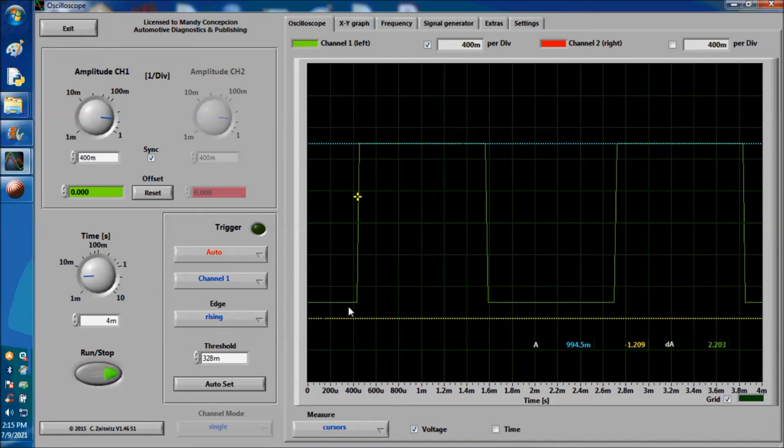Anyhow, going back to the ground side, as you can see, there is also a gap here. We're simulating a gap between the ground and the lower part of the signal. This is a square wave signal. In this particular case, this thing has to be right on the money. We're going to expand the signal, the amplitude, in a little bit, so that we can explain to you a little better what you have to look for.